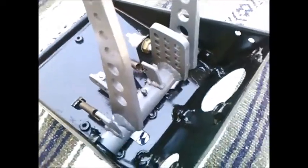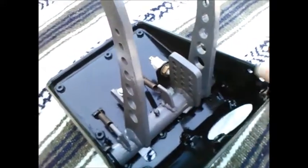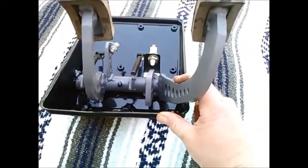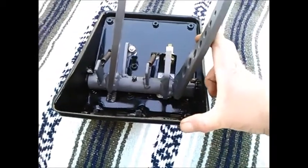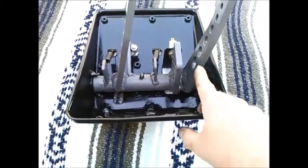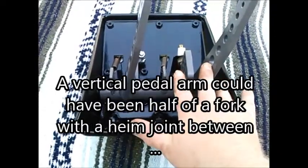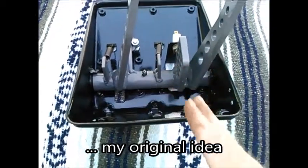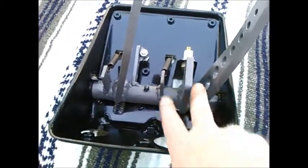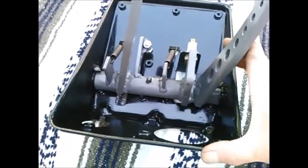Where the TR6 master cylinder had a clevis that came in around the pedal, in order to get the right-hand side brake pedal as close to the gas pedal as possible, I had to lean this way over and get into this space here. There was no possibility with a straight pedal anyway. I wanted to have two levers on the assembly with a pin going through like a heim joint, but I couldn't do that — there's not room to have two levers side-by-side. So I settled for a brake pedal that does nothing but turn the main shaft.